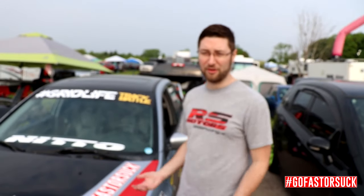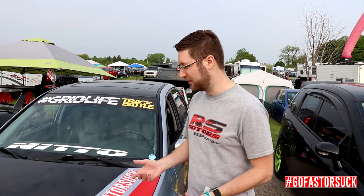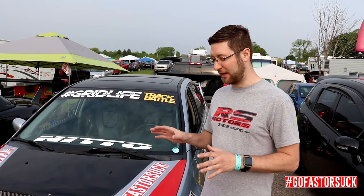See what we can do. Obviously, I'm only getting a couple laps out of the car with the speed sensor doing what it's doing. As far as an actual update on that, I have a temperature sensitive speed sensor. So what that means is I get two laps before the sensor decides it hates life and I lose ABS and active center diff.